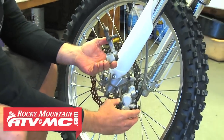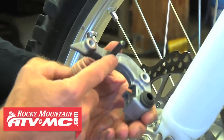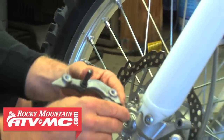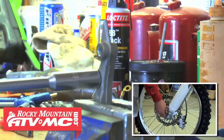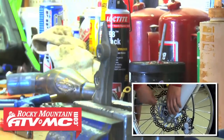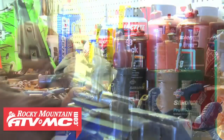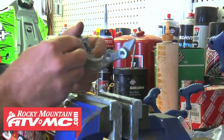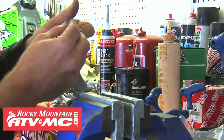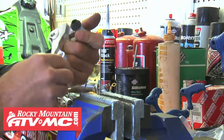Now we pull our carrier off. We're going to switch these components over to our new carrier — the rubber grommet here and our guide pin. We'll switch those over while we also pull the front wheel off. I've got soft jaws on my vise here so I'm not going to damage anything on your stock carrier. Remove it like so, then clean off the existing thread lock. Pull off the rubber grommet guide piece and it pops right into the new carrier.